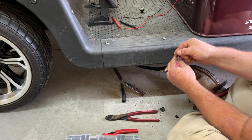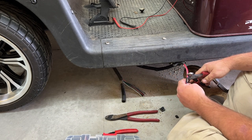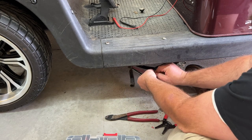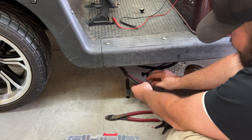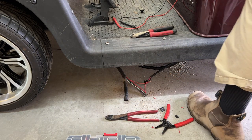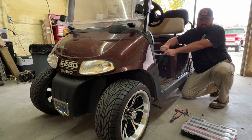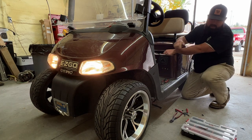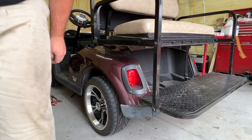This blue wire and this red wire have not been connected to anything in here. Let's strip these back — I'm going to just tie them up before putting any butt connectors on to make sure everything is as it should be. There are two wires there. I'll pull the switch up — we have headlights! They're working again. The plug down below was completely corroded. We have tail lights now as well.